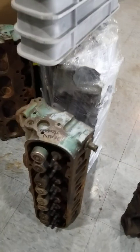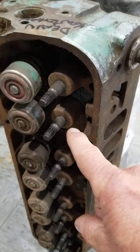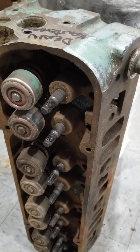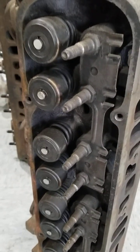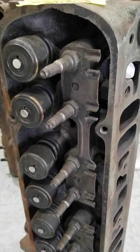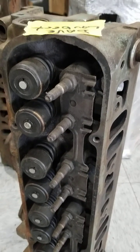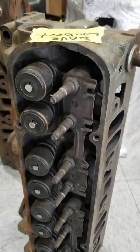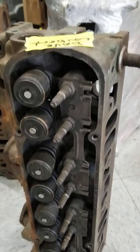Another thing I get asked a lot: how can I tell if I have a screw-in rocker stud or not? If you look at this cylinder head, the stud does not have any hex area at the shoulder or at the base — that's a press-in stud. Now if you look at this other cylinder head, this one has a hex at the base of the stud, which indicates it's a screw-in rocker stud. You'd be able to put a socket on there and unscrew it to get them out. Press-in studs you have to pull out. We convert a lot of cylinder heads here to screw-in rocker studs because so many of the early engines did not have them.